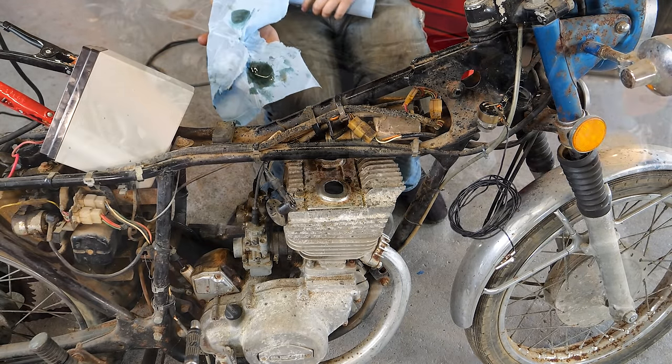For the most part, these batteries are all pretty much the same amperage. All of these motorcycle batteries are about 200 cold cranking amps, or as close as they can be to it for their relative size, some over, some under. But relative size is exactly the only thing that matters. All I do when it comes to buying a new battery is hop on the internet, look up the original battery size, try to find the length, height, and width, and then go to Walmart and look at the top of the box and match that length, height, and width, and then buy the biggest battery I can fit in that battery box, thus giving me the most cranking amps that can fit within that relative size.